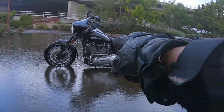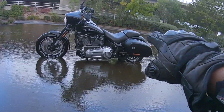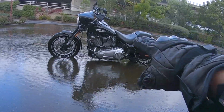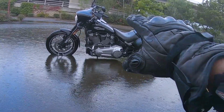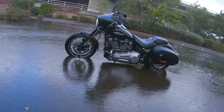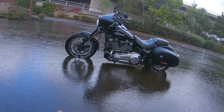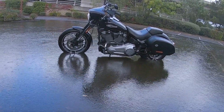And what you're really looking at is just the top of the primary, where the electrical panel is. That's where you're really going to suffer. Your intake into the engine is really quite high up. So actually, you're going to have to go through about 2 foot of water to get any water in the engine. So that isn't really an issue. Electrical underneath, let's say the voltage regulator, stuff like that. Well, actually, those are waterproof connectors there, so that isn't really an issue as well.